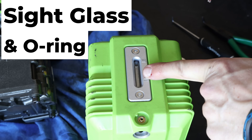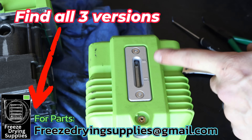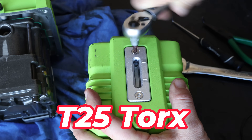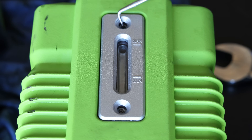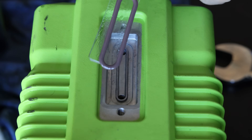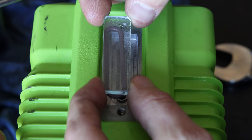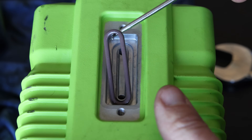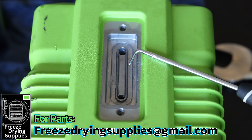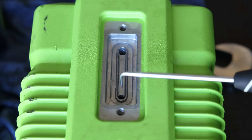One last thing on the front cover is the sight glass. There are a couple of different versions — this appears to be the newer version; there's also a round version. Use a T25 Torx with two screws to remove the front plate. Sometimes the glass and gasket come out together, sometimes just the plate. There's a piece of glass sitting between the plate and that gasket. This gasket is a common failure point — the sight glass will start leaking because of a missing or damaged gasket.